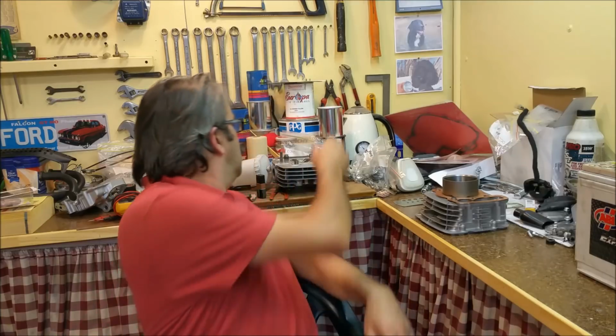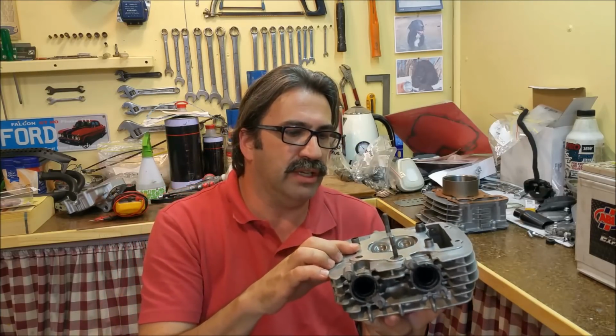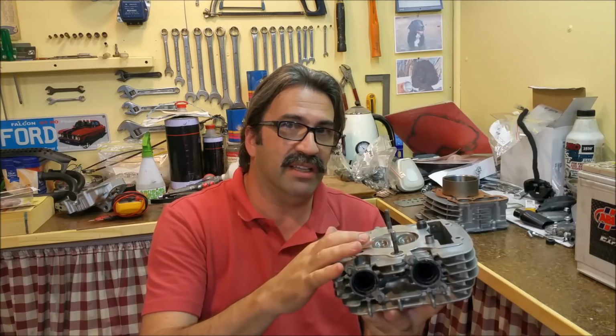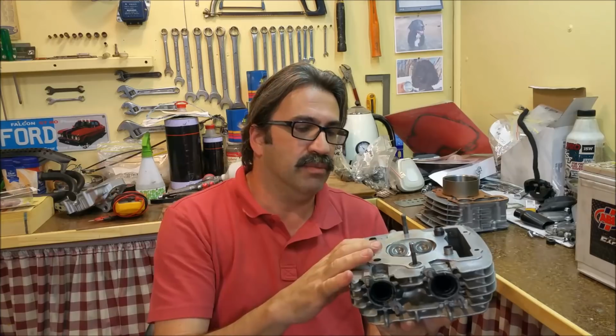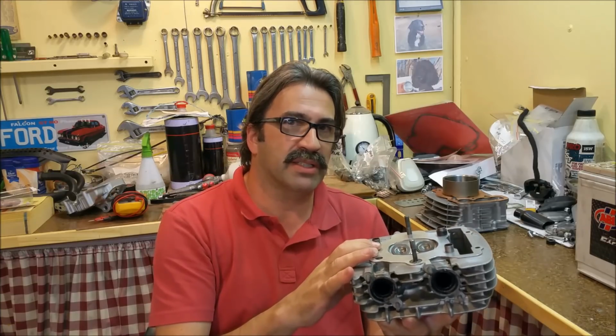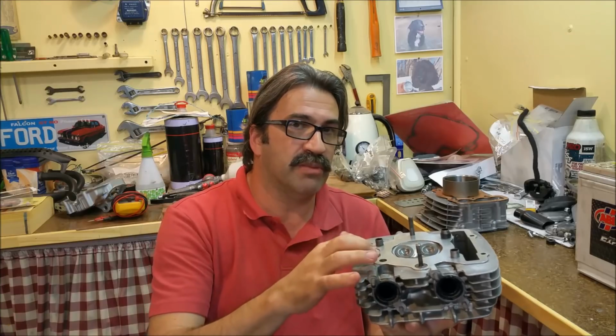Now, this is made from two different engines, and what I'm wondering is if the head's been skimmed. These have shoestring clearance, and if that's been skimmed, they're going to hit because there's very, very little room on them. Now, I can see it, but the problem with that is I don't know what the original spec is because I can't find it. I don't know what the chamber volume of these things is. That'll tell me if it's been skimmed.